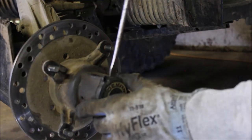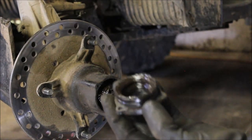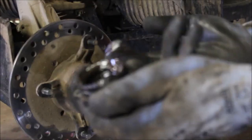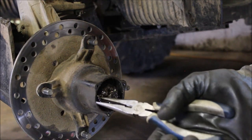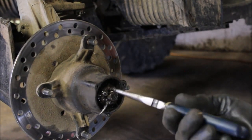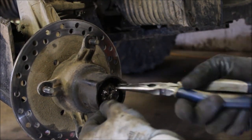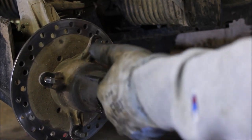Look at that — grease. It's all greased up. That's a big no-no, and the reason why is because dirt can get in there, stick to your grease, and you're going to have it packed with dirt and mud. You don't want that. What you want to use is either your Polaris brand or automotive ATF — automatic transmission fluid. There will be guys that debate that, but back in the '80s Polaris used to put ATF in their transmissions.